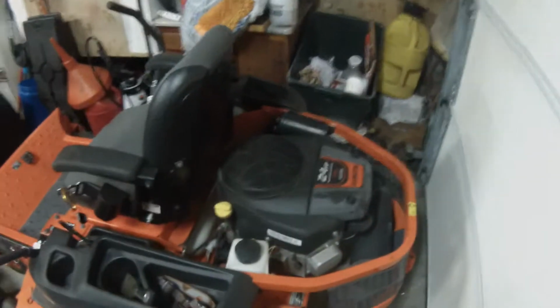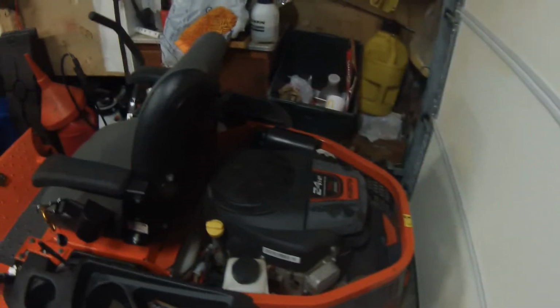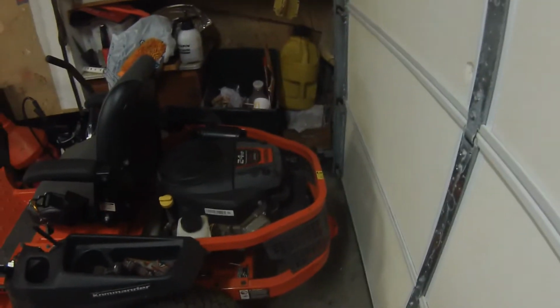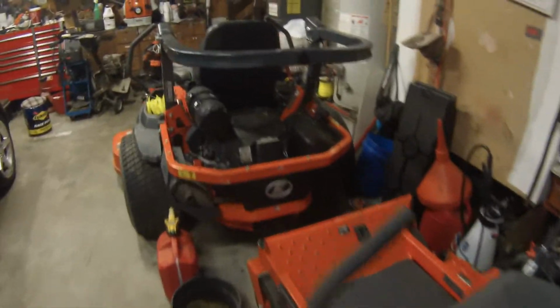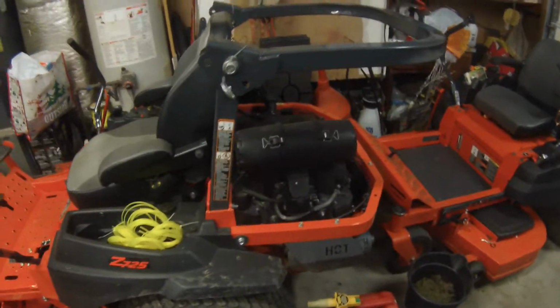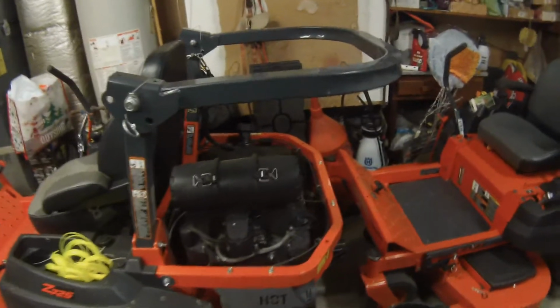And as far as the air filters, I try and take the air filters out once a week and shake them, and they normally last about a year, and I just replace them once a year. The oil and transmission fluid changes on both of them, I just pretty much go by what the factory says, and I keep a notebook of how many hours are on the engine and transmissions. Change them when I need to.